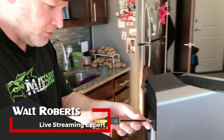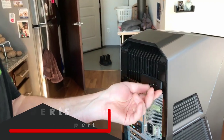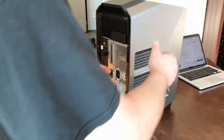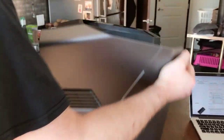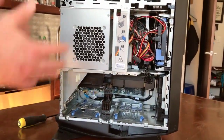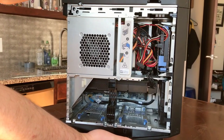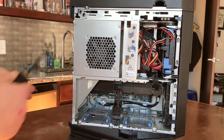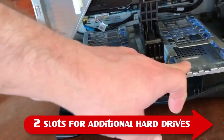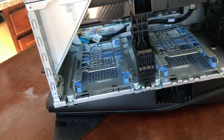Okay, let's crack this case open. This is the R7. You just take this screw out in the back to unlock it. So as you see, this is what I would call a typical Dell build — Dell likes to take their mid-tower. This is considered a mid-tower. A lot of people look at it and say holy crap, that's a big tower, but this is mid. There's still room to grow in here, plenty of space. Notice you have space for more hard drives — you can put in two more solid state drives, and you can even buy third-party brackets to add even more.